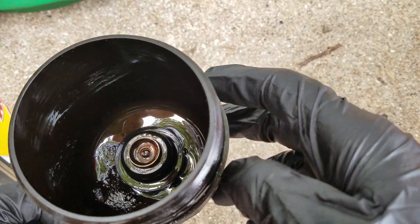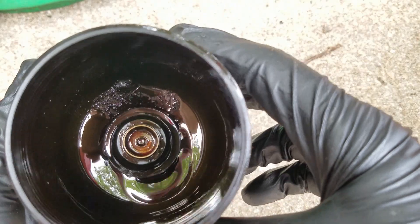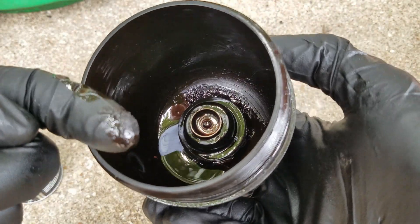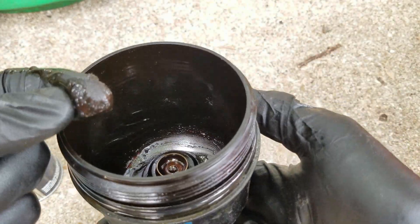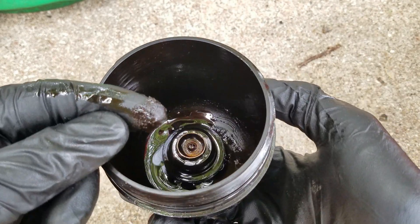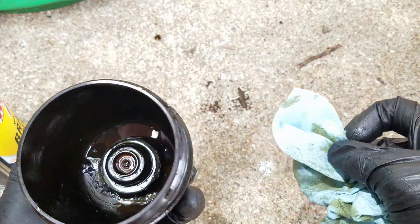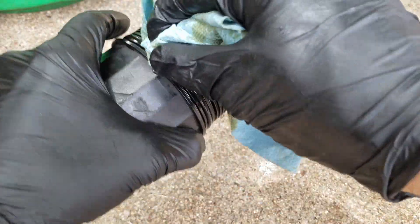Let's take a look inside the oil filter housing cap — I'll get some brake cleaner and look down inside to see what kind of stuff we've got. We've definitely got quite a bit of crud in that corner up there and some more over on the side. Unfortunately I was using a FRAM filter this time around — they are garbage — but I did have this thing completely clean before I put the last oil in. It looks like the AutoRX did break it up and it made its way down to the oil filter housing. I'm curious to look in the oil filter itself.